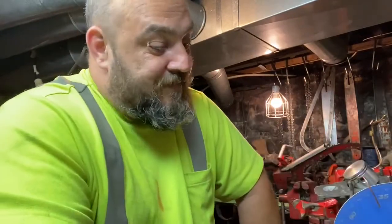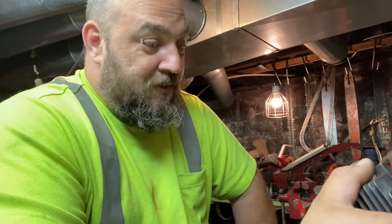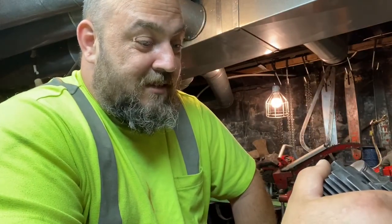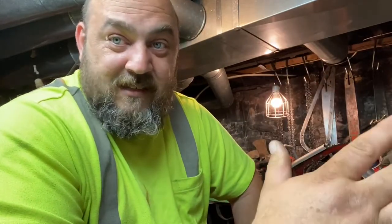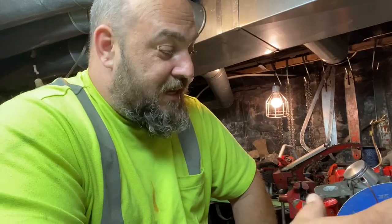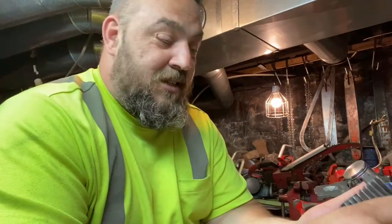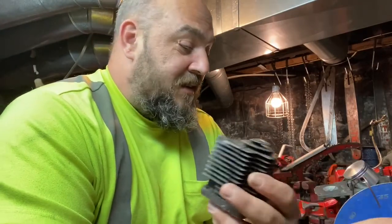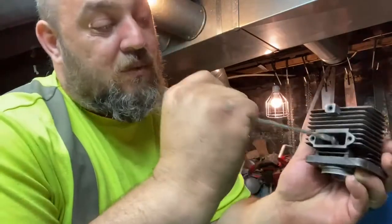And a lot of people really liked the performance of that saw, and I think you would too. But that's the whole secret to this. So now all I've got to do is set this exhaust to 103 and put the saw together. That's all I've got left to do. But the only other thing I want to touch on is your exhaust shapes and so forth. Some folks want to widen, so let me give you a quick general rule of thumb here.